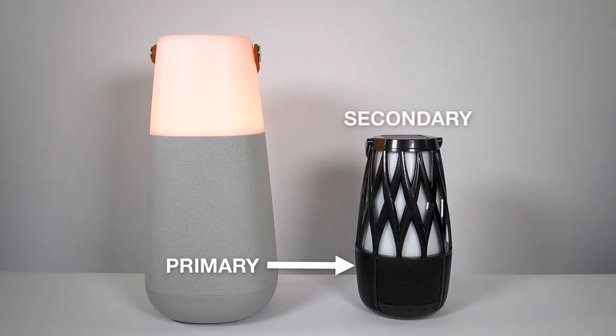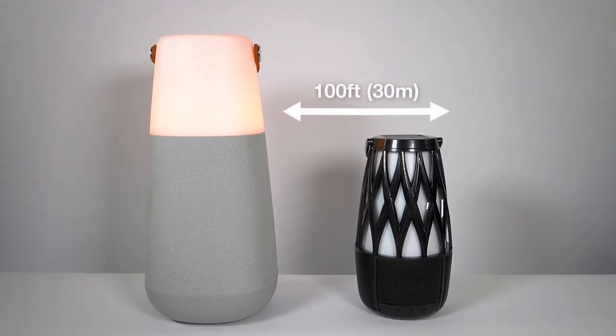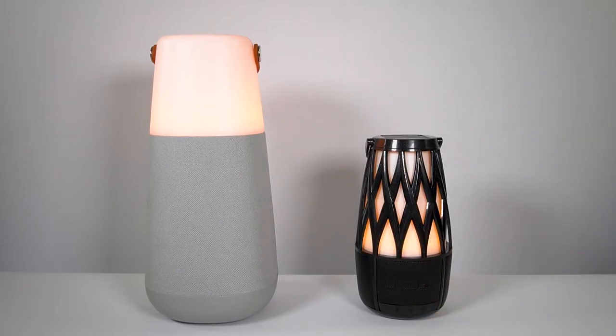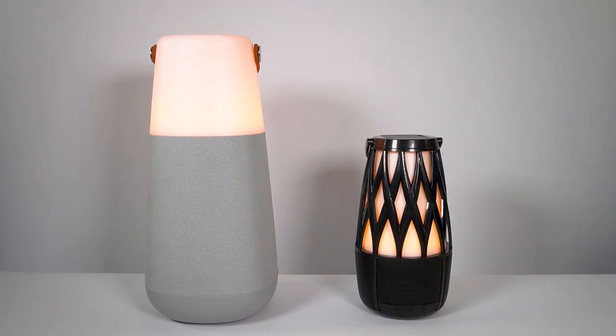Those speakers will be your secondary speakers. Double-press the Bluetooth button on your primary speaker to enter multisync mode — the speaker's LED will change from blue to white to indicate this. Make sure that any secondary speakers are within 100 feet or 30 meters of the primary speaker; the closer they are, the faster they'll sync. Now, power on any other speakers you want to sync to your primary speaker. Here I have an Ion Audio Tahiti speaker, so I'll double-press its Bluetooth button to turn on multisync mode, and it will automatically sync to my primary speaker. Now, any audio that I play from my Bluetooth-connected device will be sent to both my BrightMax and the Tahiti speaker.